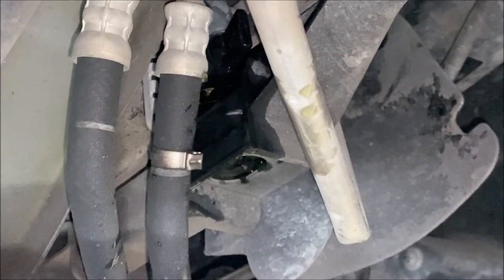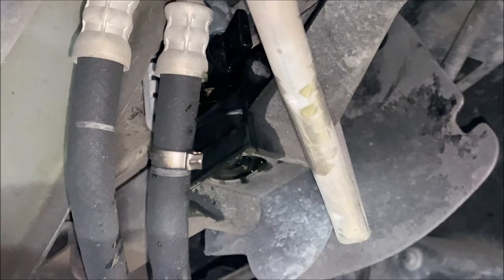And that's it. You get that 180 degree turn and it'll hit a hard stop and it's fully sealed. You can see that the dripping has stopped from the radiator drain, which is also a good sign. So that's all there is to it for this 2014 Chrysler 200 with the 2.4 liter four cylinder dual VVT motor.